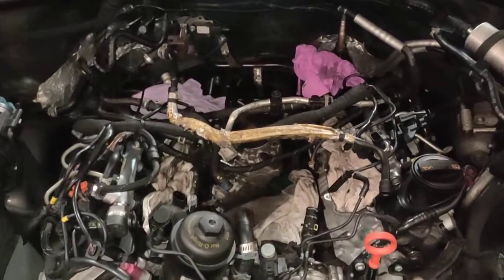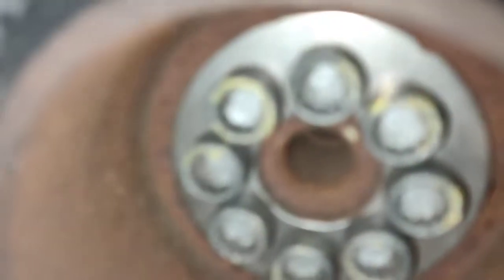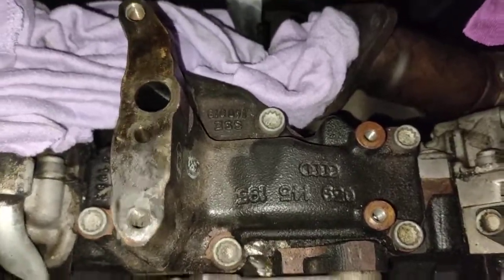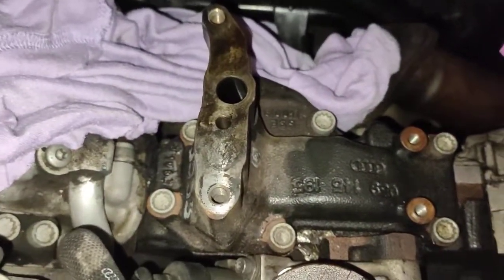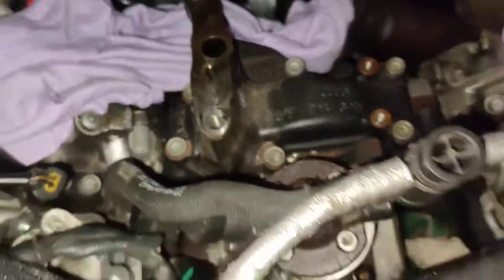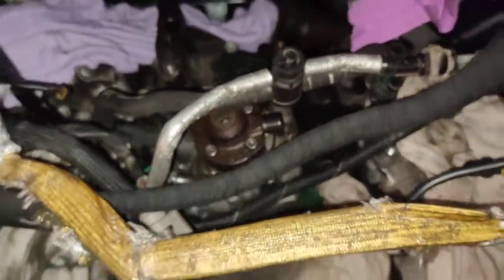This is video one, I'll do video two and I'll remove this out. There are a few special tools you'd need to move the crank. There's a tool that goes in there to remove that so you can actually move the crank, so you can put a pin on top of here and put a pin inside there — that goes that way — to hold the sprocket before you take it out. Whatever you do, do not remove the pump without taking that top cover off and putting the pin through the sprocket.